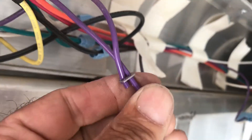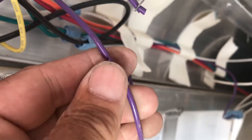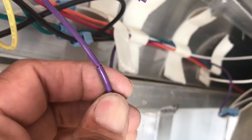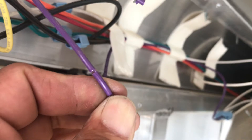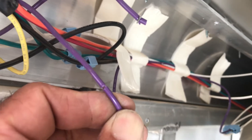The reason why we've got a problem is because the factory loves to use these quick splice connectors. The problem is quick splice connectors pinch through the insulation hoping to make contact with the wire. Manufacturers love them. Us RV repair guys hate them.